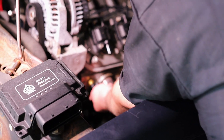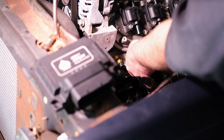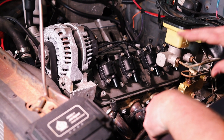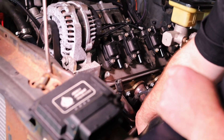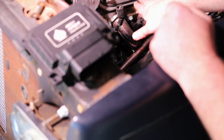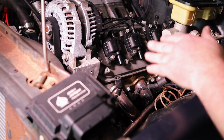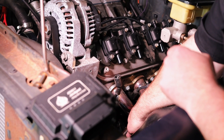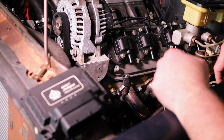Get the boot lined up — you'll feel it kind of click into the little recess. Coils are on the brackets, sitting on the valve covers, ready for bolts. Spark plug wires are in and nothing is touching the header. On these swap headers they are close to the steering shaft — we actually had to dent the headers a little bit just to clear it. Be mindful of this depending on your engine mounts. If those engine mounts degrade over time, your headers will start touching there and you'll end up with either a binding steering condition or unnecessary damage to several hundred dollars worth of headers.